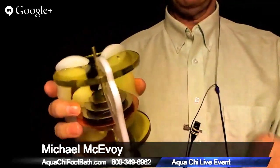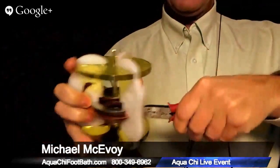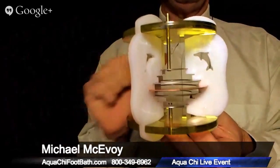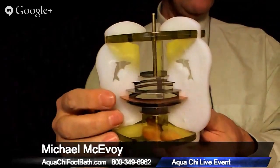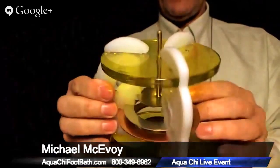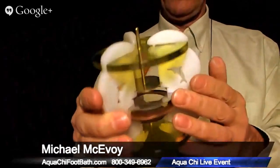First, start by taking out the ring set. Okay, and then you have your ring set removed. You can see you have just the spot there where it was. At this point, you have to remove one of the white legs in order to get at that copper ring in the middle. You can't just slide it out because it's locked in by these white legs, okay?